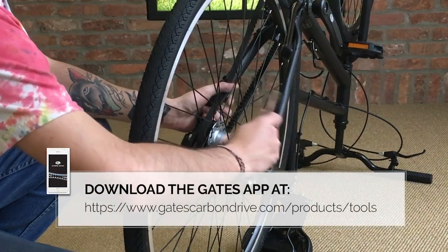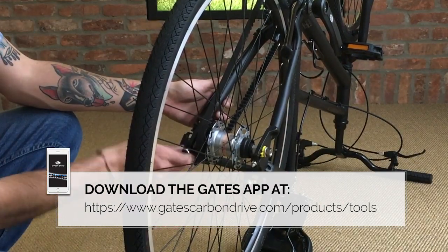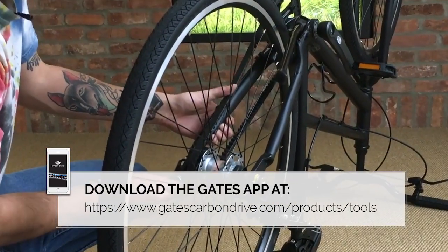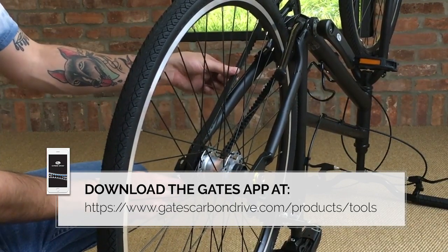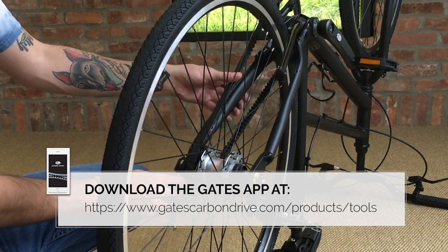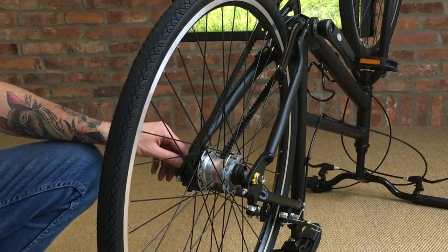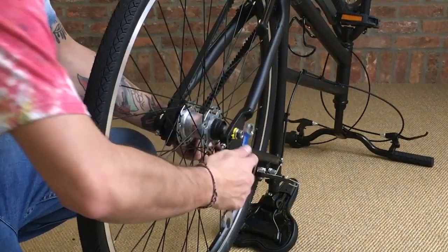And the ideal tension is going to be around 50 Hertz when you're using the Gates tension app. You can do a rough estimate by plucking the belt itself. And if you get a high pitch, it's usually a little too tight. If you get no sound at all, it's definitely too loose. What you're looking for is about a dull kind of thud until you can accurately measure it. Once those guys are tightened down, you can take your 15mm wrench and tighten down the axle bolts themselves.